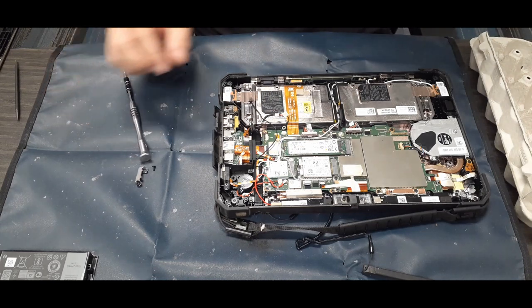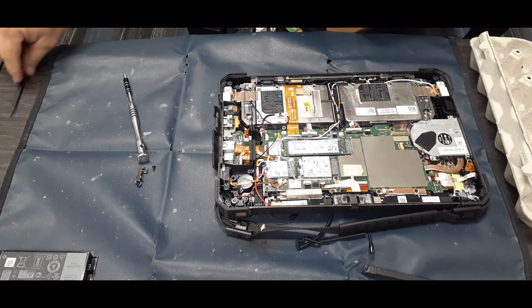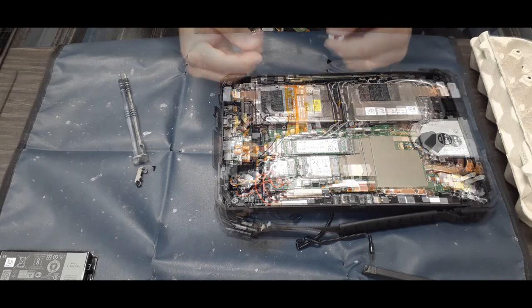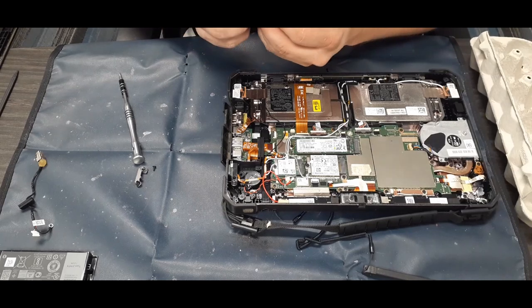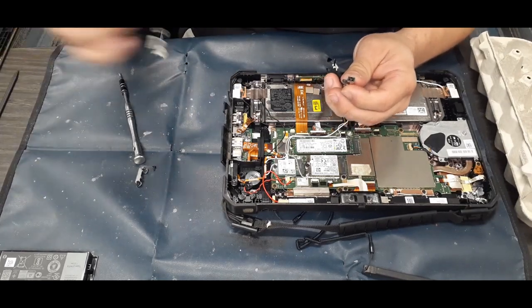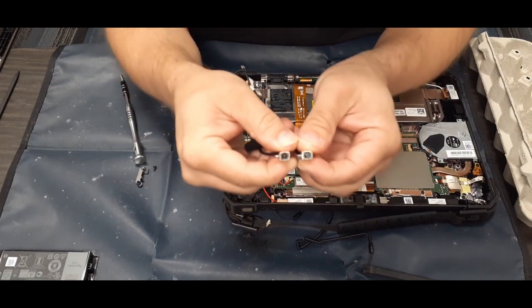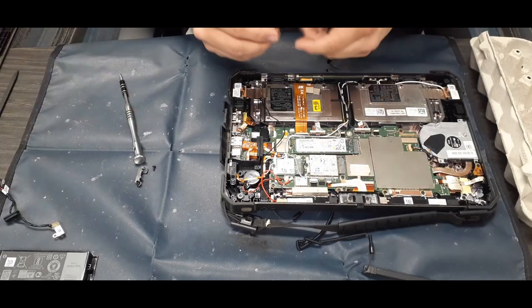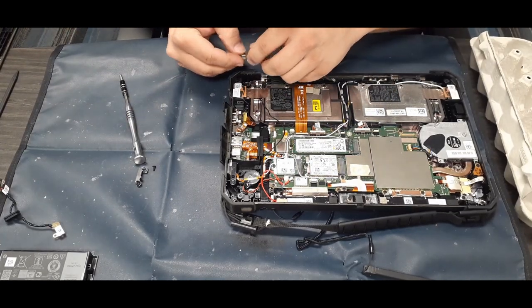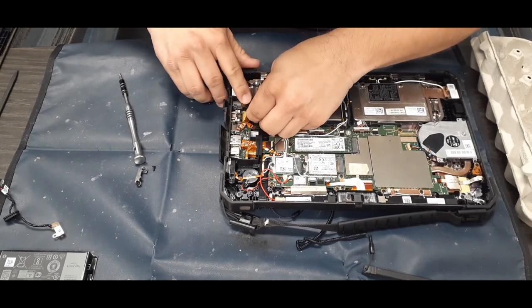The rubber piece is actually attached to the DC port wire, so it gets replaced along with it. You have to pull that flat cable out. Right here you can see the comparison: the one on the left is the broken one, the one on the right is the good one. The good one has a plastic piece with a little hole in the middle; the broken one had that piece broken out, with contacts floating around inside — and because of that, it wasn't making a proper connection.